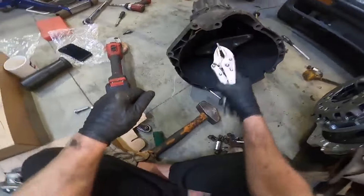Now that we had a running car, we needed a driving car. A driving car needs brakes, clutch, and a throttle, so we installed a pedal box. We also had to come back and address the steering knuckle issue — the engine would not fit with the steering column tapped and the manifold on, and finding a way around this took absolute weeks. I tried modifying the manifold and we made three custom steering knuckles.